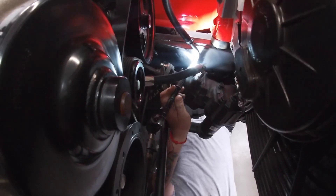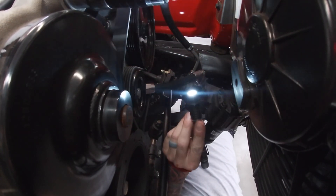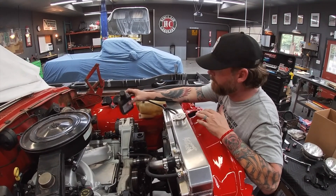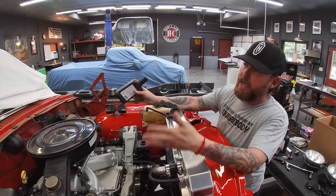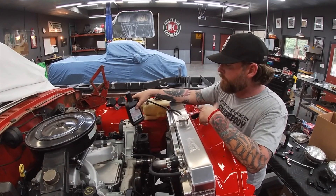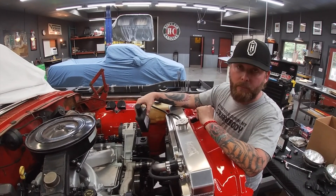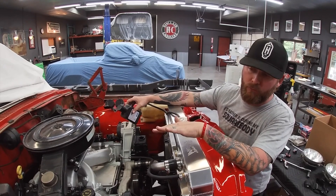You can see we've already put the return side in on the gearbox — it's just a factory hard line with a low-pressure hose that goes up to the reservoir. When we initially fill up a new gearbox, new pump, and all that stuff, we add all the fluid to the system. Then without the engine running, we jack the front of the vehicle up and cycle the steering wheel back and forth — pretty close to lock-to-lock — about 20 times. You'll see it working tons of air out. Then we let it sit for about an hour so any air bubbles disperse, top it off, and do that a few times before we ever run the engine so it doesn't risk burning the pump up.